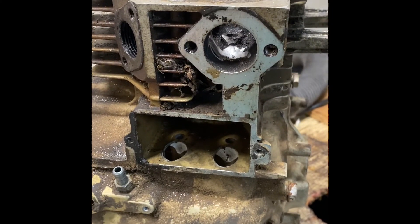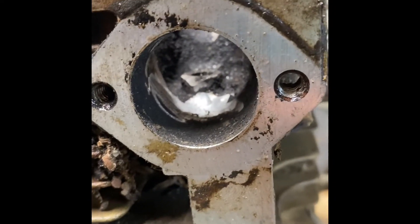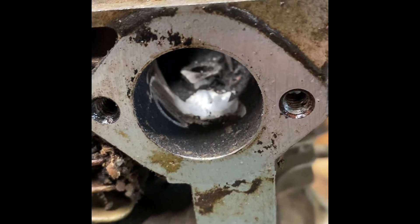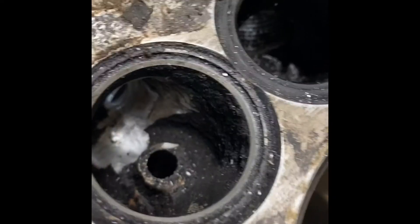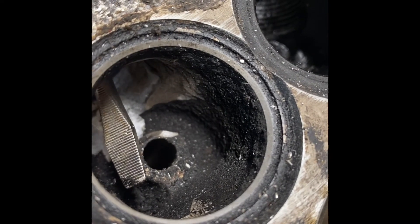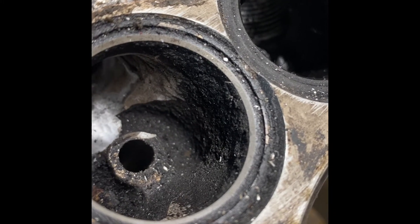I'm going to be moving the phone around and shuffling it a bit, just bear with me. This is our port — remember, we already did the basic port cleanup: went in there and cleaned up that short turn, took that edge off, got rid of the sharp edges. Here's a good view of your valve guide boss right here — see how that's thick? This area is kind of thin. We're going to take a round cutter and basically plunge it right in here. That will widen up this area and narrow this area. Coming in with a round cutter from the top, we'll get material out of here and blend that up to the seat in that bowl shape. That will increase the flow on the floor by a ton.